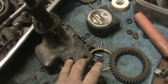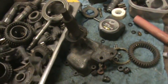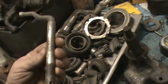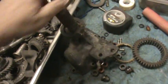Those are both off a car because the mount holes are not side by side. Do some research on the nose cone differences and the shift rod differences. You can take your other transmission apart, see the shiny dogs, snap them off with a punch, put it back together and it won't jump out of gear. But more than likely it's the incorrect hockey stick and wrong nose cone on the transmission.